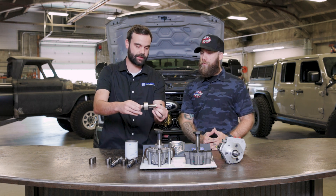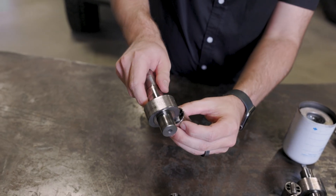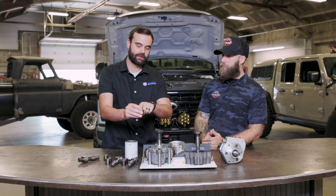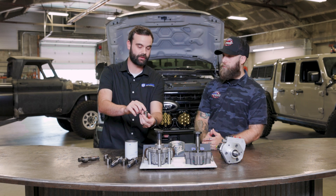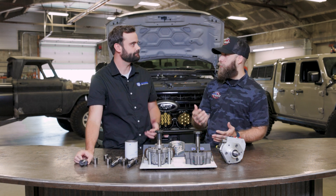It's an aggressive two-lobe cam design. In a perfect world the plungers ride on that cam all day long, going up and down pumping your high pressure fuel. What can happen is if you get a piece of debris stuck in that roller, it can cause that roller to skid and then you're creating metal debris — which is super common with diesel fuel.